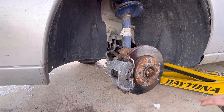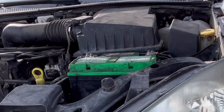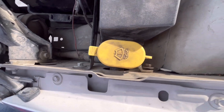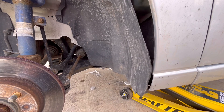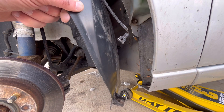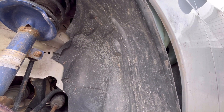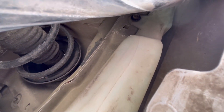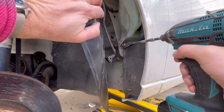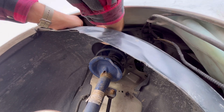This is where the cursing begins, so I'm going to pause it. You're going to need a 10-millimeter to access this bolt right here. Just going to loosen that. Here's the connector right here — goes into the top of the pump for power. You can see there's another 10-millimeter bolt we've got to get out, and there's another one right up there. This doesn't quite fit perfectly square but it will work. I just need to get this one loose too — I don't think I have to get it all the way off.